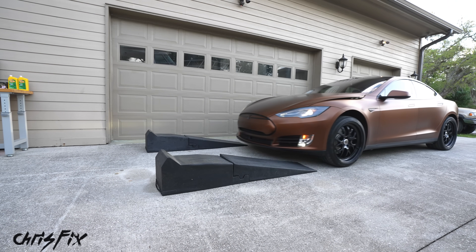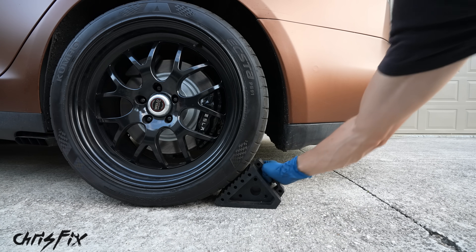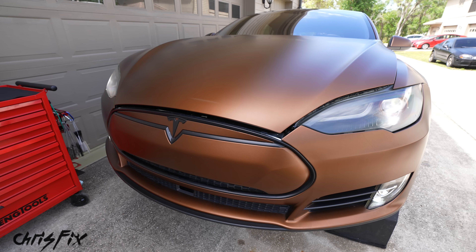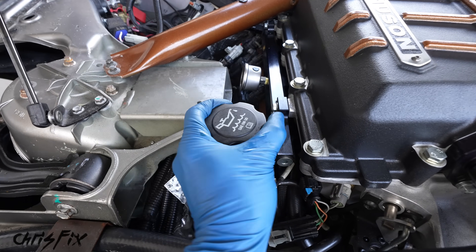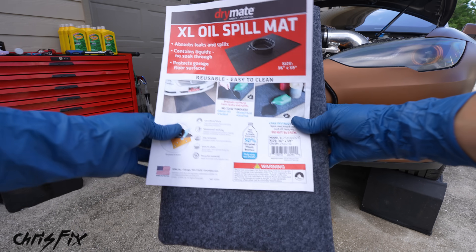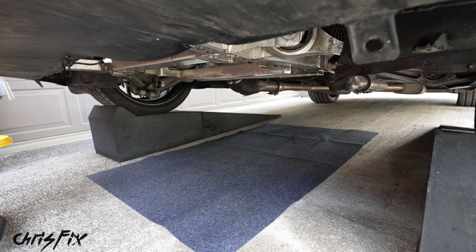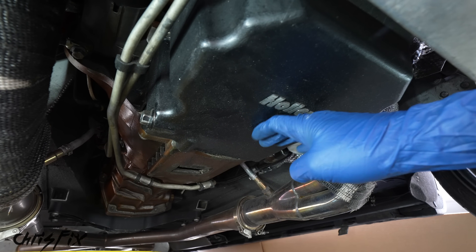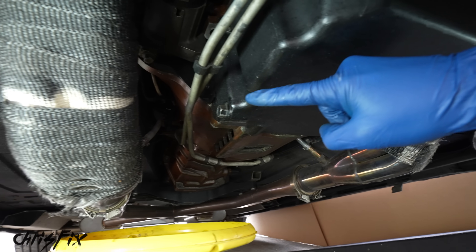Back at the house, get the car up on some ramps or jack stands, whatever you have. Then chalk off the rear wheels and pop the hood — to do that, go to the center screen and just tap the hood, then the hood will pop open. Slide your hand under the latch and lift it up. Anytime I change the oil in a car, I like to remove the oil fill cap, which lets the engine breathe better so the oil drains quickly. And I like to use an oil spill mat which absorbs any spills. Slide that under the car, then get the oil catch pan under there as well. Under the car this is pretty clean — we have our oil pan right here, our drain plug right there, and over here we have our oil filter. Let's go drain the old oil out.